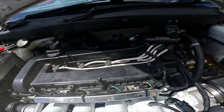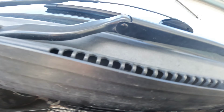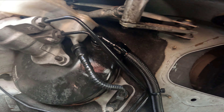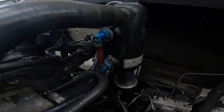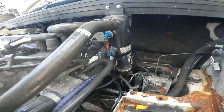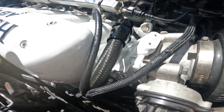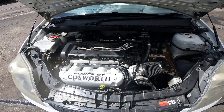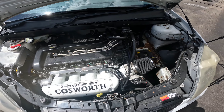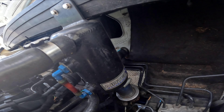We are all back together — as you can see, the pipe routes along here and along the brake lines and then up to the servo. The reason it's wet is because I sprayed a bit of WD-40 whilst it was running just to do a leak test, and we were all good. The pipe runs across around to the front of the manifold, and I think for quite such a small detail it does make quite the difference.